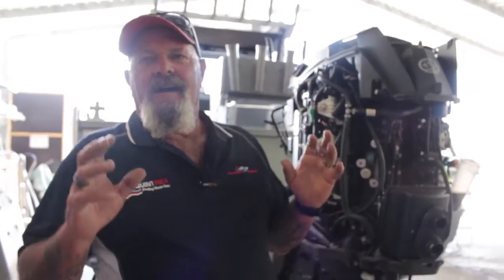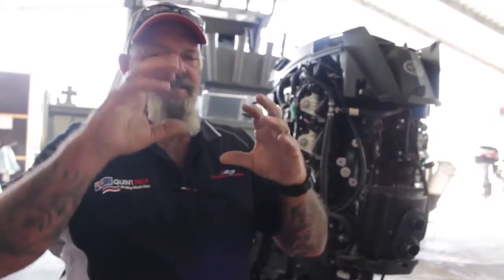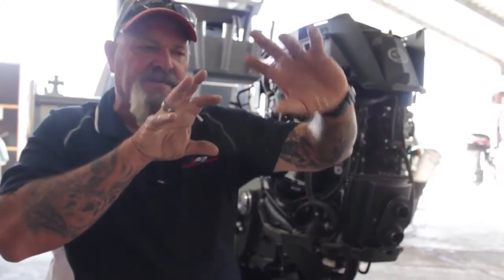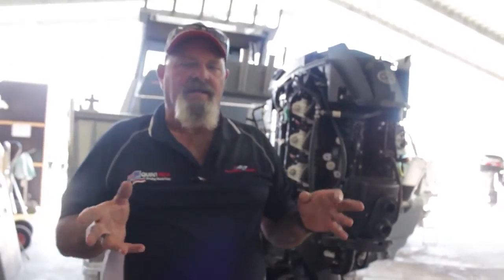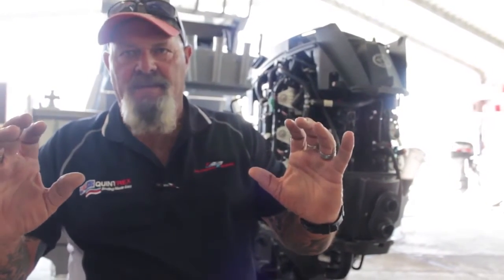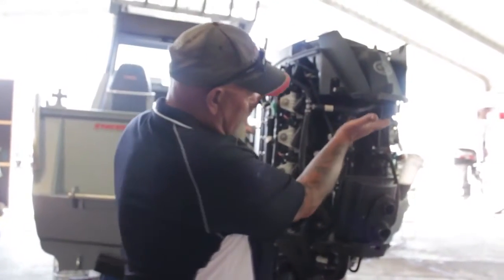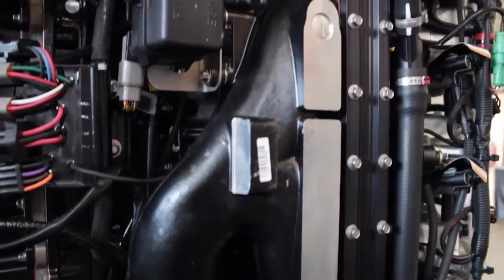I'll quote Harley-Davidson here — the best gain in any performance is to have two equal exhaust banks. With a Harley-Davidson you won't see two pipes just going like this; they're meticulous in making sure the rear pipe length matches the front header. They pick up constant length and produce it through one exhaust outlet. Contrary to what a lot of people believe, expelling exhaust through two uneven pipes is not as performance-gaining as propelling it through one. Evinrude has done that with starboard exhaust porting — previously race-bred technology, now standard in the Evinrude G2.